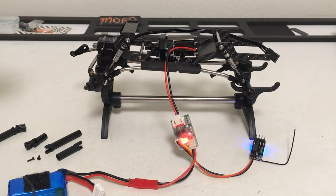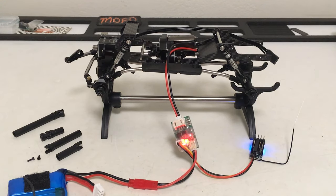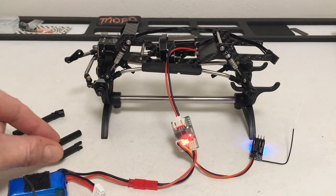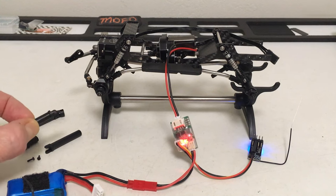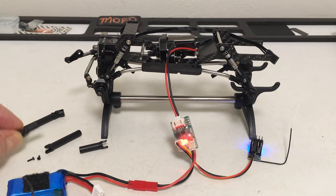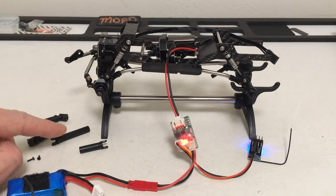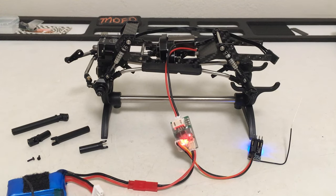Motor sounds good. So I'm going to get these drive shafts installed, and then we can give it a little spin up and make sure the motor is turning the right direction with everything connected. But a note on the drive shafts, you're going to need to provide your own JLU front female. That does not come with the short medium drive shaft set. It comes with the deadbolt instead. So we're going to swap that little joint over here, and then it comes with the deadbolt and the C10 rear. So we just need to swap the joint over to the C10, and we'll have both the JLU C10 front and rear ready to install.